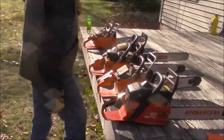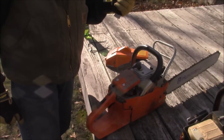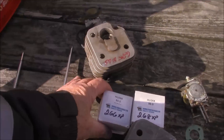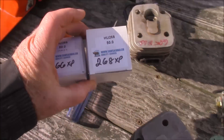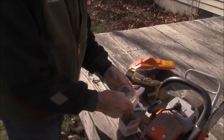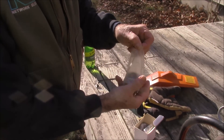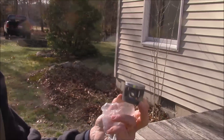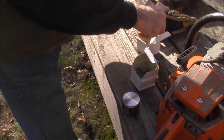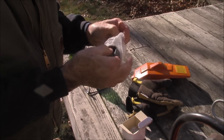Let's start with the scenario: a guy gets a 266 that's blown up. There are two ways to go — if you can clean the cylinder up and stick a piston in it, that's always the easy way. Originally the 266 came with full skirt pistons. These are pistons I get from my buddy Chris at Saw Salvage. That was the original 266 piston, but it doesn't really matter because it's completely interchangeable with the later piston, which is still available OEM from Husky. It's both 50 millimeter.